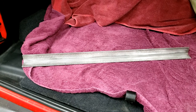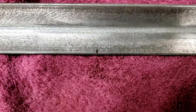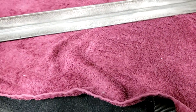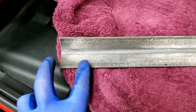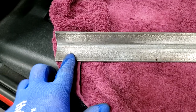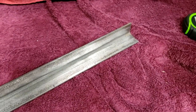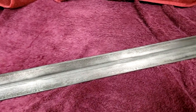So I've cut this 2-foot piece and another, after measuring out, that's what I want. Marked off here where I'm going to drill the holes for those bolts to bolt it down with the top. And then I'm not going to miter or anything. I'm just going to lay the cross piece of angles on top of here and bolt it down with 2 flatheads on each corner. And that will leave an 1/8-inch gap all along this strip, for, right now I'm just planning on putting OSB on it. I've got some OSB here, so I think I'm just going to use that. So I may tack weld on just some pieces of 1/8-inch to fill that in.